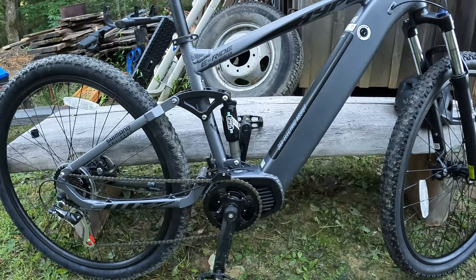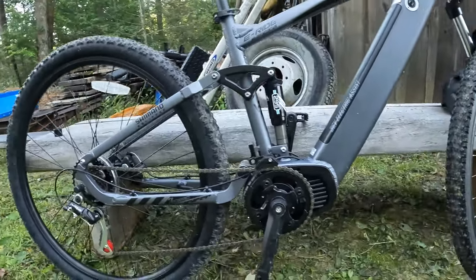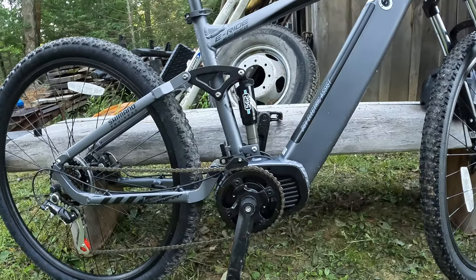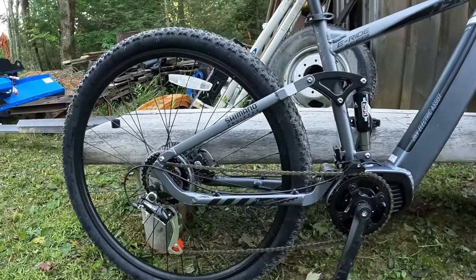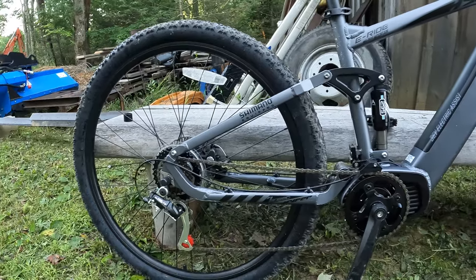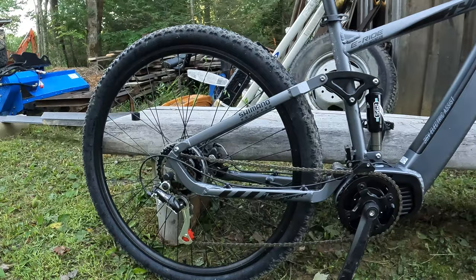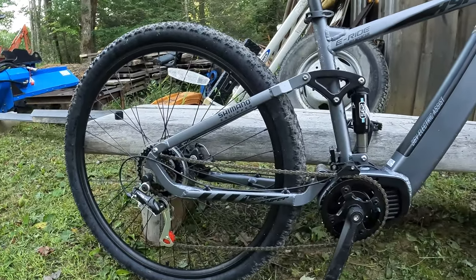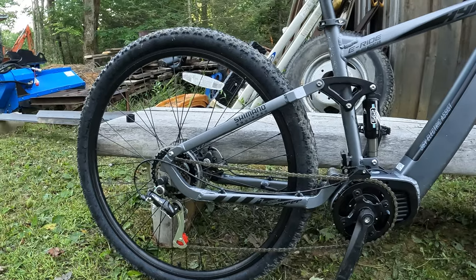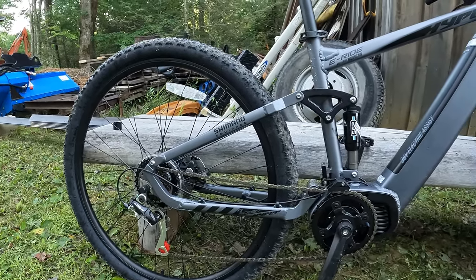So I counted the teeth on the chain rings. So the front is a 38 tooth and the rear is a 14 to 34 freewheel. So it's not a cassette. Probably maybe be worth updating or upgrading that eventually, but